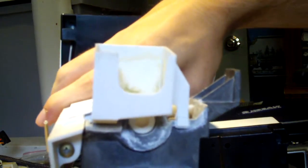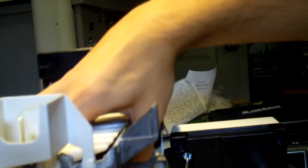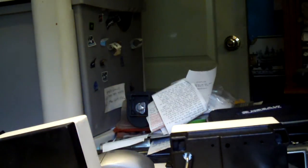And unfortunately, you can't just take the fill cup off of this one and install it on this one, because this on-off lever hangs on to this. So that's a problem. If you look here, you can see, they're totally different designs. So unfortunately, you can't just take this fill cup and switch it over to the aftermarket ice maker. Not going to work.